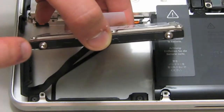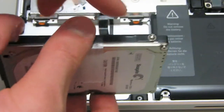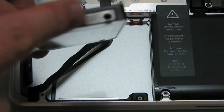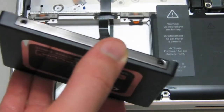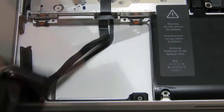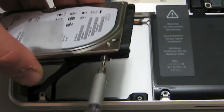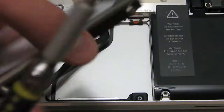The hard drive will have four Torx screws, two on each side, that the mounting brackets use to hold it in place. The new drive will have four holes for these screws on it. Using the number 6 Torx screwdriver you will need to remove the screws on the old drive and attach them to the new drive.